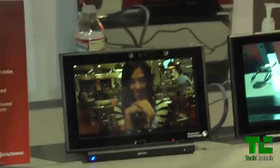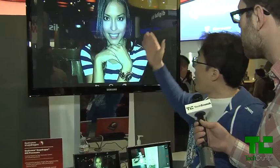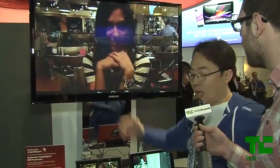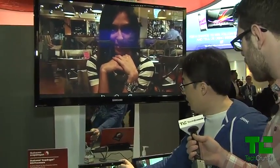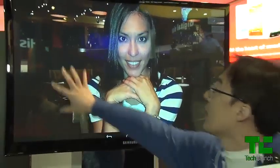Without flash we can get this kind of picture — I can see everything, but in general it's pretty dark. So when we run Chroma Flash, we take a flash-on picture and a flash-off picture very fast, and then fuse these two to make the final output. More natural color, more natural brightness, and you can even see the background. That's happening so fast the user won't even notice, because our processor is fast enough to take those two shots within a couple of milliseconds.